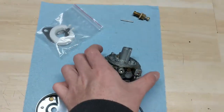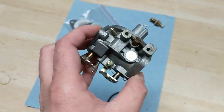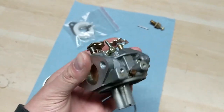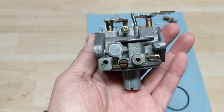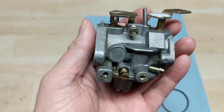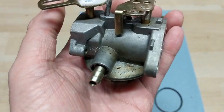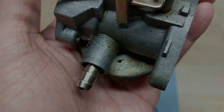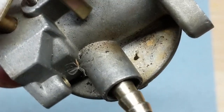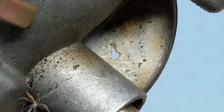So what is wrong with this carburetor? Why would it run perfectly — other than revving up every now and then — but be hard to start? The snowblower wasn't priming. If we look at this carburetor, you can see it looks to be in excellent condition, fairly new, until you come right to there. So what I'm going to do is spin this — you guys see that? That's a hole in the carburetor.